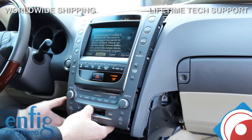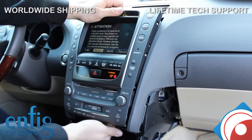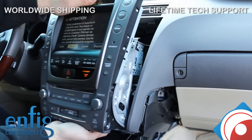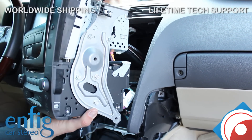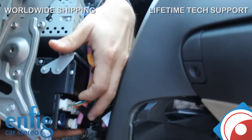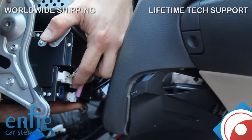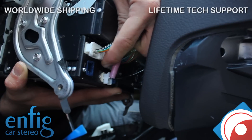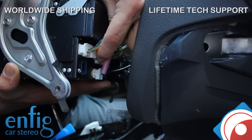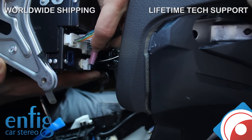Now this is very important here — this is very soft plastic. It's a nice Lexus dashboard. So what I recommend is when you pull out the radio, hold on to this and hug it for dear life and have a friend do this. This is the connection — the second connection here is the one we're looking for for the iPod. You just got to squeeze it like that and remove it.